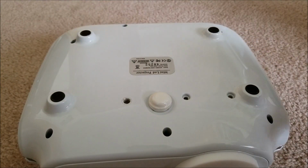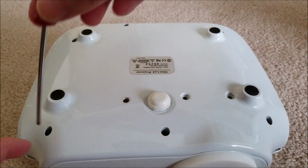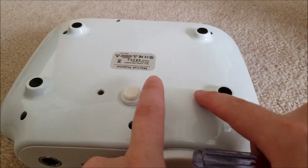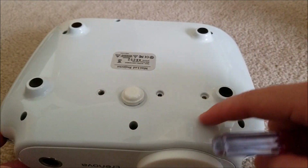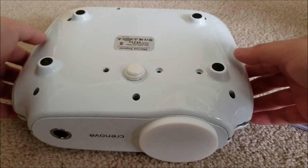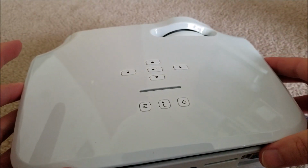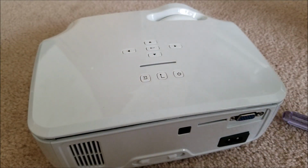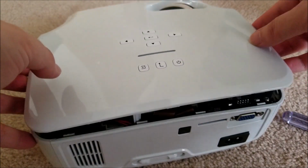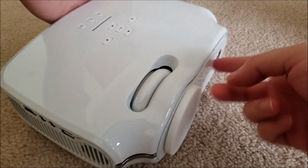Okay, so whenever I see exposed screws, I have to open it up. Basically, pretty easy. Everywhere you see a hole, there's a screw in. There's 2 here, which I believe attach the frame for the lens. I don't think those are necessary to actually open this guy up, but all the other ones are. And there are tons of clips around, so if you have a pry tool, you can just get in there and work all the clips loose. You have to be particularly careful around the front because there are clips into the front bezel here.